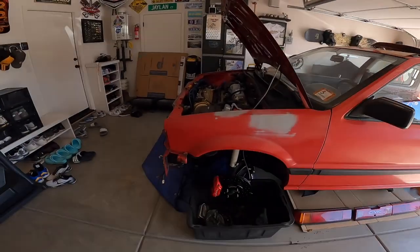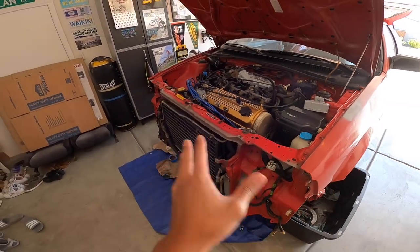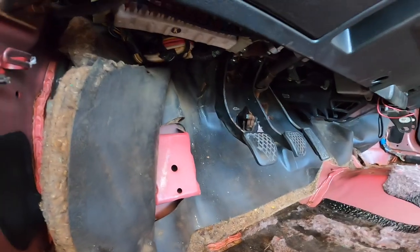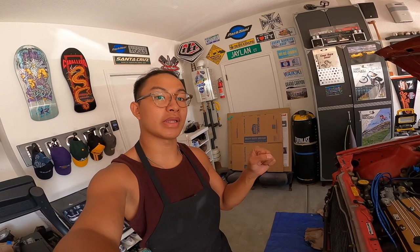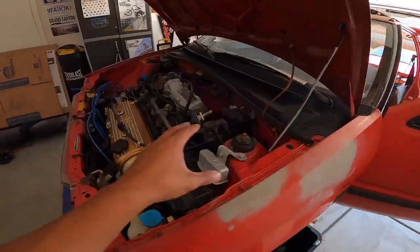Today on the chopping block we have a clutch cable to replace. The clutch cable attaches to the clutch pedal, which engages and disengages the clutch by pulling on a wire. On older cars there's adjustment on the clutch pedal itself to tighten it, as well as adjustment on the cable on the inside. If your clutch isn't engaging, you want to tighten up that cable because sometimes there's too much slack. In our case, because this is a 30-plus-year-old car, the cable has actually stretched over time and we've maxed out the amount we can tighten it. We have a new clutch cable right here — we're just going to detach everything and replace it.